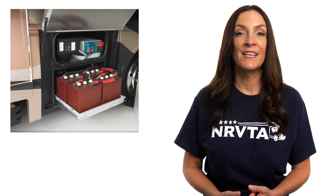Some lead acid batteries require servicing while others are maintenance free. It's important to know where the coach batteries are located so that you can perform periodic visual inspections. Travel trailers are easy to spot as they're on the A-frame area on the tongue of the trailer. Fifth wheel coach batteries are in a storage compartment outside, and motorhomes vary in location — either in a storage compartment or under the entry steps. The lead acid coach battery is always located outside the RV because it off-gases hydrogen that is not meant for us to breathe.